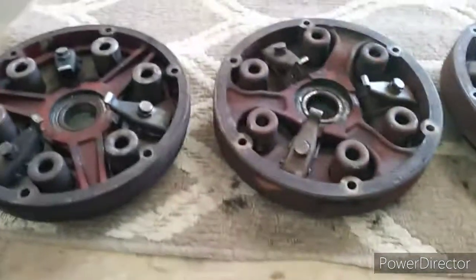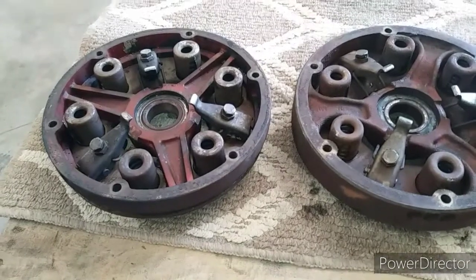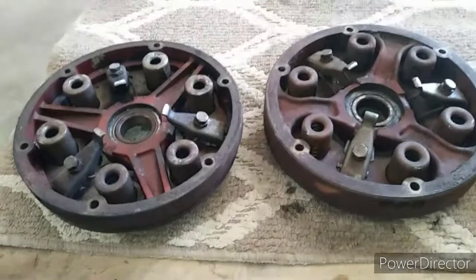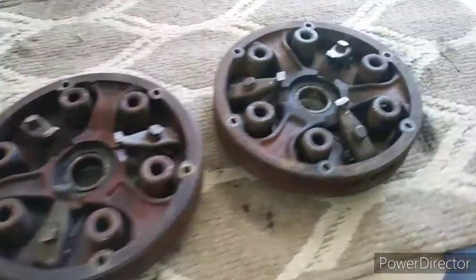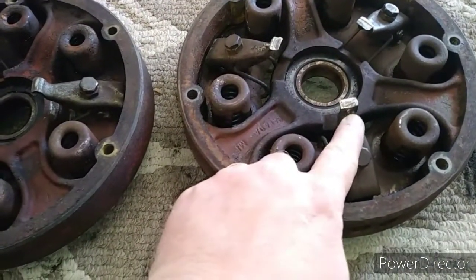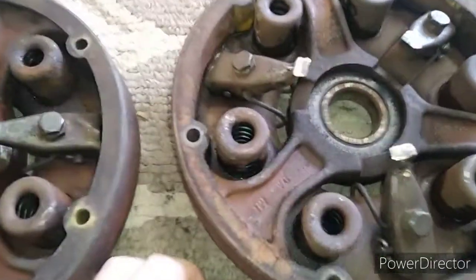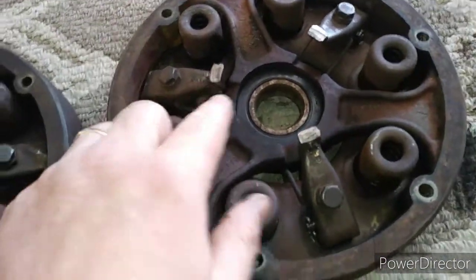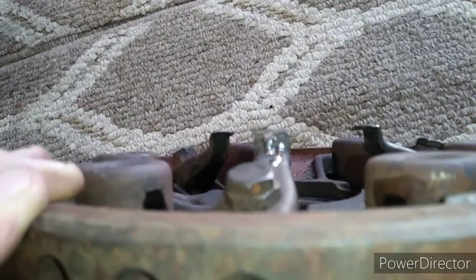I have taken everything over and used Napa purple cleaner on it, power cleaner. I call it purple lotion. So I'm just going to talk about the pressure plates. This is the original pressure plate here, the 3 fingers that goes up against the throwout bearing. They are profoundly worn. I don't know if you can see how thin they are.